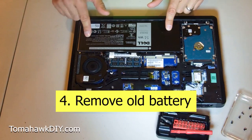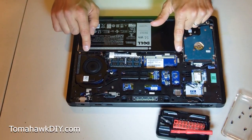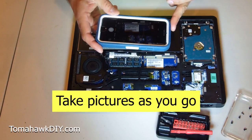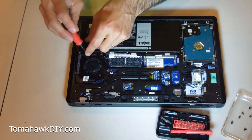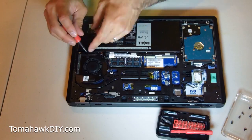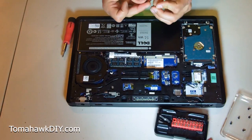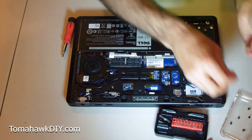Now to remove your battery, there are some screws. Depending on the model, you may have one or two screws in here — this one's got a couple screws right there. I'm taking a picture of this with my cell phone as I go. I'm going to look carefully to see if these screws are different from the six I just removed; obviously you don't want to mix them up. They look like they're the same, though I can tell these two original ones had some thread lock on them — the other six did not.